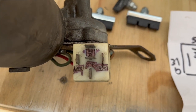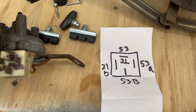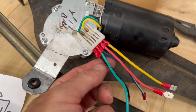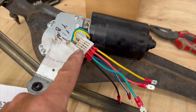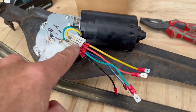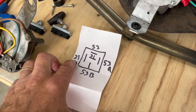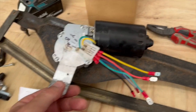These are the numbers on the harness on the motor — this is on the '79 Bay. What I've done is corresponded these colors with the corresponding pins on the updated motor. I did a bit of research and found the T3 had this configuration, though the T3 had a different number for the ground and 31b. I'm going to try it and see what we get — hopefully we get some turning.